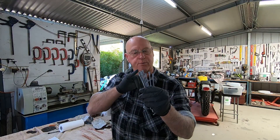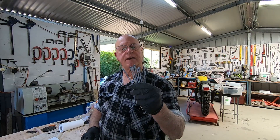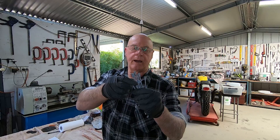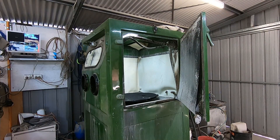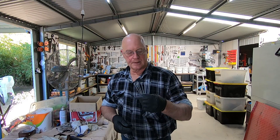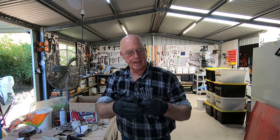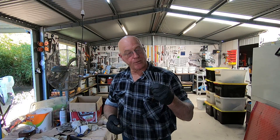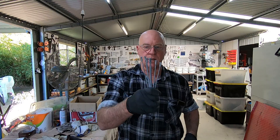The next thing I'm going to do is put these, still attached to the spokes, in my wet blasting cabinet — my hydro blasting cabinet — and clean them up. Not everyone's got one of these big cabinets at home, so you can probably prep these on a wire wheel on a pedestal grinder and get a good result also. But anyway, we'll chuck these in the wet blasting cabinet and clean the nipples.